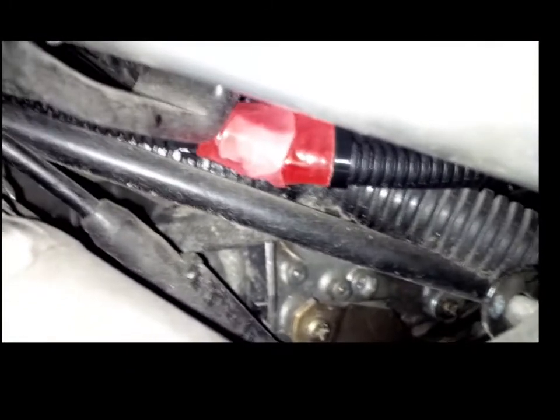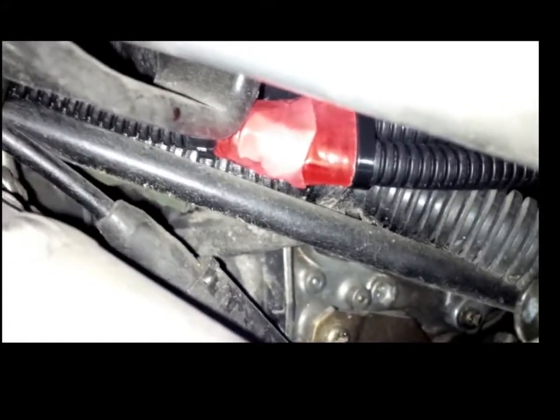I did have this wiring loom out a few times, three or four times I think, just to make sure that it was properly positioned, that it was as clean as possible. For example, the original loom that I designed had two conduits, one for the positive and one for the negative wires coming from the back of the bike. To keep the headstock area clean, I decided to merge them. That's where this red tape is, so the two conduits merge into one. Obviously need to find some black tape, didn't have any, but works for now. And that's it really. It's all looking quite smart, and it's all working very well.